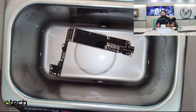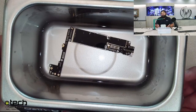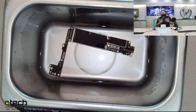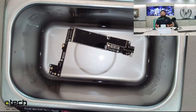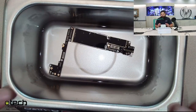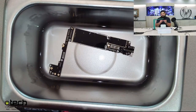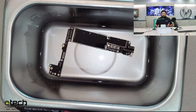I've, in my repair lifetime, probably fixed maybe a couple dozen liquid damage devices. And when I say fix, I've attempted the repair. My success rate has probably been 50%. And again, lots of variables there. But in most of those cases, when I couldn't fix them, it was something like salt water. And salt water, if you're near a coast or say where there's a lot of water activity, I highly recommend having one of these, because this will probably help salvage the majority of your saltwater damaged phones, because it'll get that salt loosened from the board and prevent that later corrosion from happening.